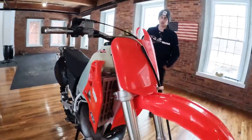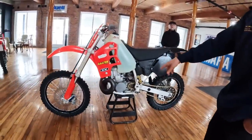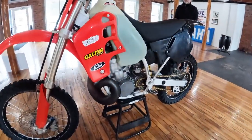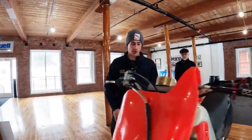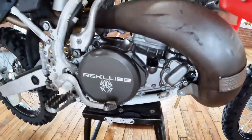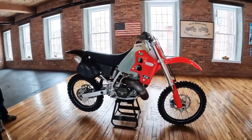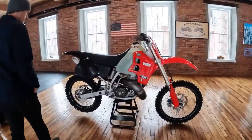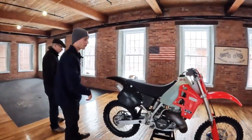I've actually tried the stock pipe and wasn't a big fan. The bike came with the Works pipe, which you cannot buy anymore — discontinued. Almost think the previous owner might have wrapped it around a tree, because one side of the case looks almost brand new while the other side looks like it has a lot more time on it. That's another thing — the water pumps rot on these after sitting for some time. I took this to Glamis and noticed it was really pushing a lot of coolant through, and I almost think it needs an updated impeller since this thing is 23 or 24 years old.